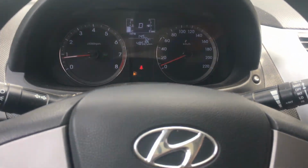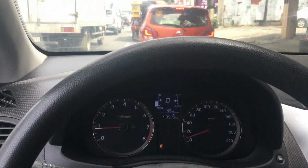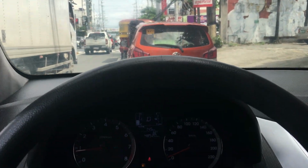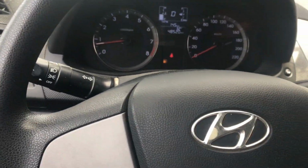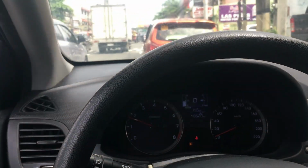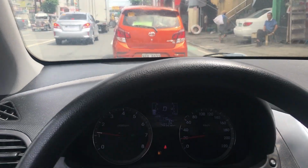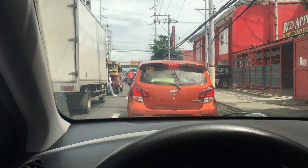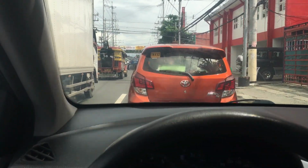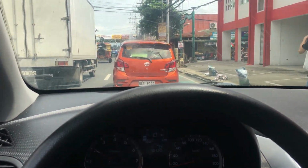Taking this thing out for a drive and trying to get the cylinders to wear in a little bit. I have to sometimes shift it into neutral and drive to make sure that the engine doesn't die. That's the side effect. So this thing has to be driven far and a lot now to wear in the cylinders better and make my compression better, because you all saw the damage to the cylinders. It was kind of rusty, and you can only do so much with sandpaper.